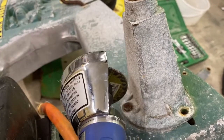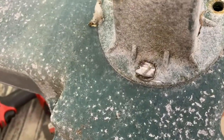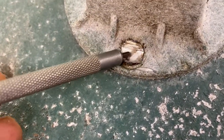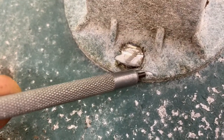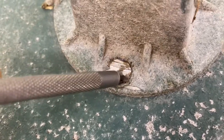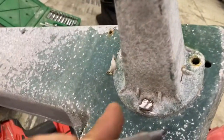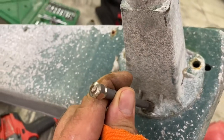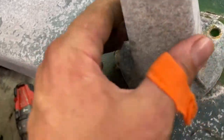What I'm going to do is take a cutoff wheel and basically grind that head off, trying to stay out of this piece, and that'll let that bolt come out. I couldn't film myself grinding - I'm the only one in here in my shop. As you can see I've ground almost all the way through. I didn't want to grind anymore because I don't want to hit this case. I nicked it a little bit right there but I'll be able to sand that out - it's just a scratch. I've got a makeshift punch here and I knocked it out.